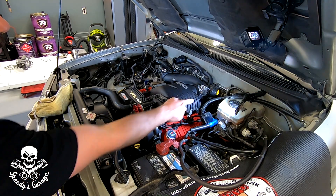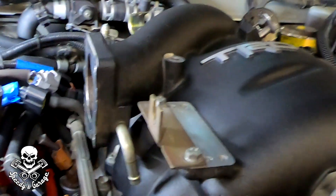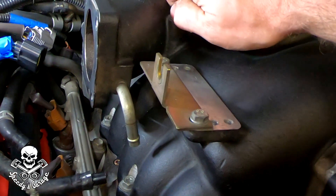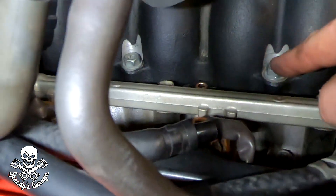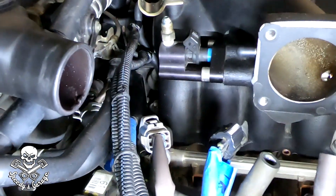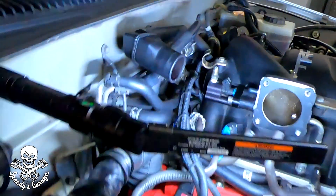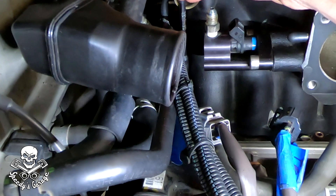Start the little bolt that holds the bracket and spacer first to hold the supercharger up. I noticed the supercharger bolts were getting a little galling, so I put some anti-seize on them — I didn't do that on original installation but I am now. These get torqued to 13 foot-pounds and are 12-millimeter. For the back stud, I used a magnetic 12-millimeter nut holder on my impact driver so I wouldn't drop the bolt in that tight spot. It worked.